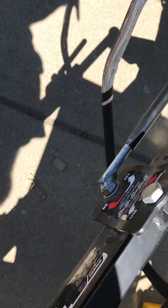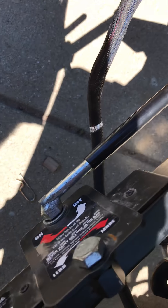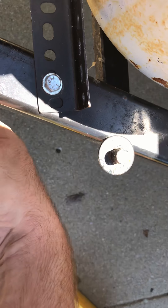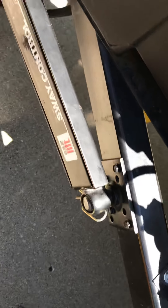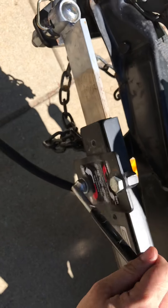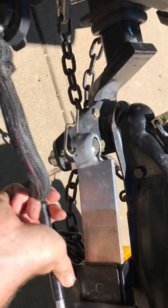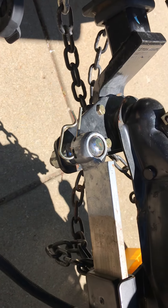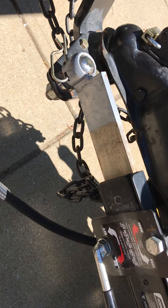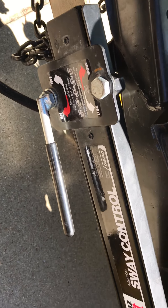Line it up enough so that I can get it onto the hitch. It's very important when working with the anti-sway — we lock this in place here — never to back up with the sway bar on, or at least not any significant turns. The sway control goes on now. We loosened it three full turns, so we're going to tighten it three — one, two, two and a half. I think that's about right — two and a half turns, and that puts the sway in place.